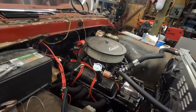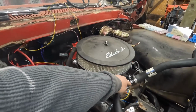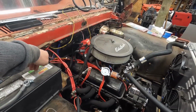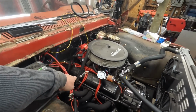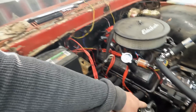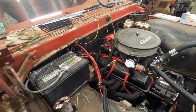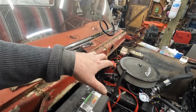So, anywho, yellow is getting triggered from the relay from this thermal switch. Fans are grounded. The relay is grounding through the thermal switch. And then we're just powering the power steering with the other relay. That's the main fuse for that. It's 125 amp. I'm going to try to snug down the distributor because it's really, really loose.